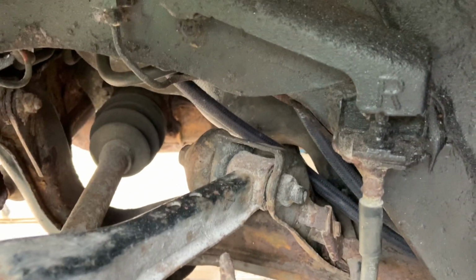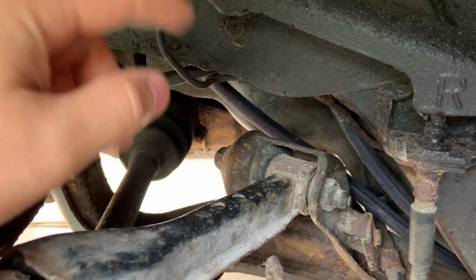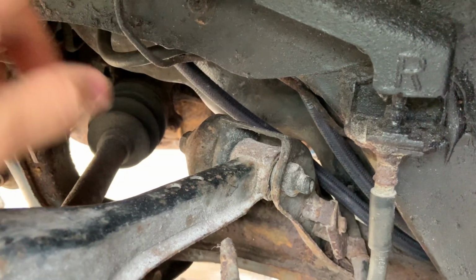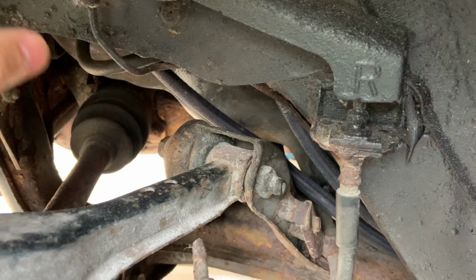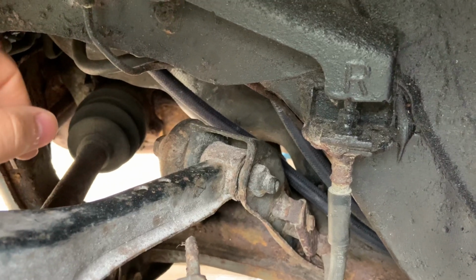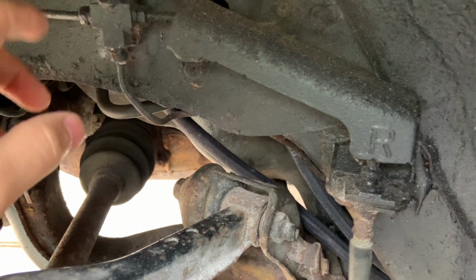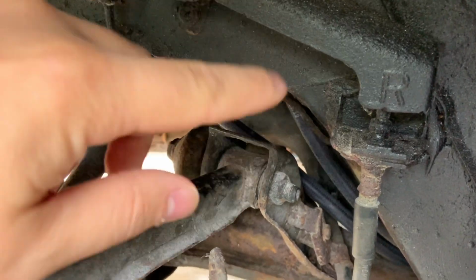So what we've had to do then is rebuy new lengths of Gates high pressure ethanol fuel line, and then what we've done this time is run it straight from the fuel pump all the way down, and then obviously one into the fuel filter and then one into the return line. So we've got a nice continuous line all the way underneath. A bit of a pain, but I feel a lot safer knowing that it's just one line and we're not going to have any leakages. We have tested the line since and there's been no leaks, but we've just got to work our way around securing this underneath the car, which I'll get underneath the car in a minute and show you what we've done to the underneath, as in protecting it, and how we're going to go about securing these lines, and then explain where we've run them.